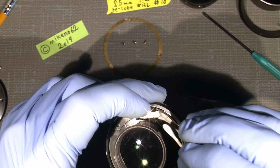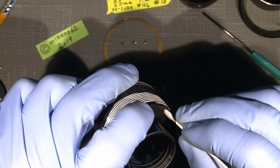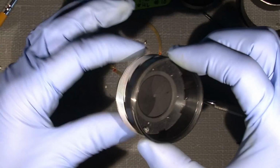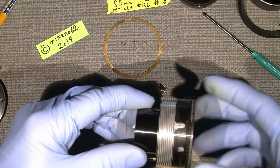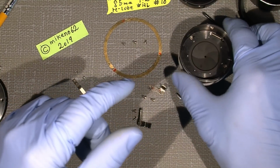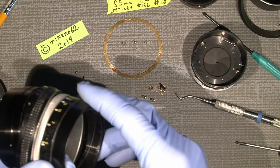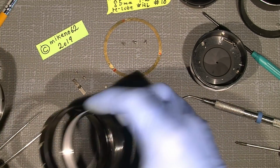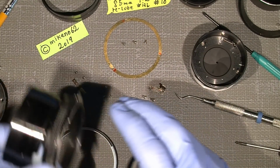It will just make it easier to get everything in correct order. Well, I should have made the focusing issue before doing the aperture, but since I was in the lens with the aperture assembly, I think okay, it's time for a focusing cleaning. Now all parts are here and ready to be lubed and put in again.